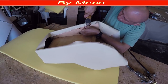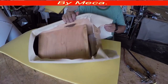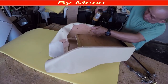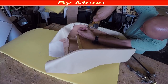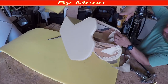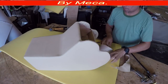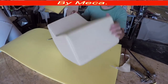When you see that center console on the car from any angle outside, it should be flat. Inside, behind it, it doesn't matter. This center console will have a speaker on the side, so I made everything for that — I made it big enough for two USB ports, a phone charger, the stereo, and two small speakers. It will have a lot going on inside. Now I'm trimming the vinyl all around and it looks nice. I have to make some cuts there for the stereo.